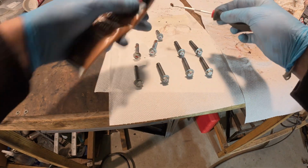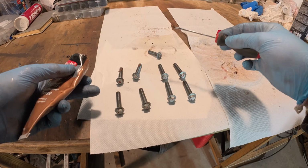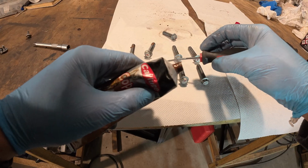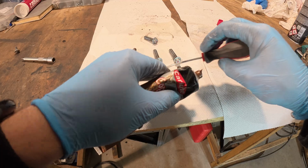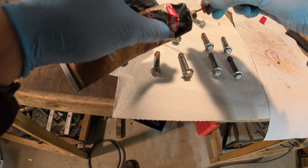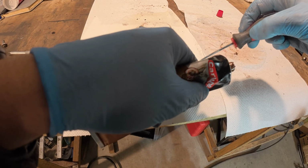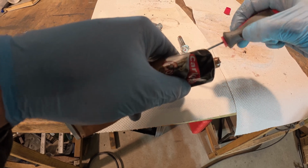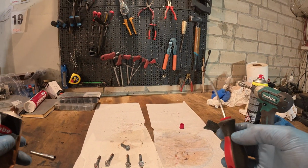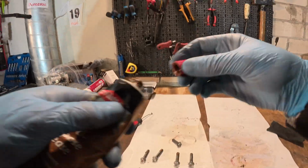No, that's not this one. This one will need the Loctite. The 4 bolts, I should put some copper grease because it prevents rusting. And also some behind the head. The torque value is gonna be more correct because the surface won't stop it. That's it.